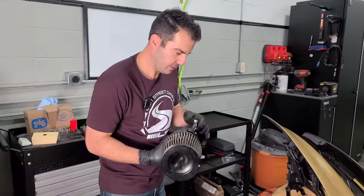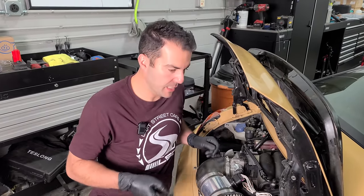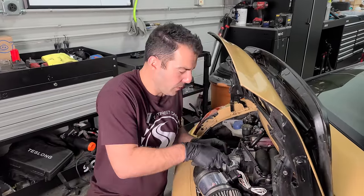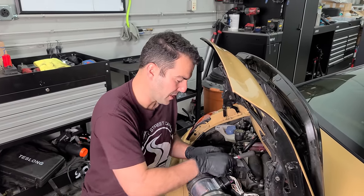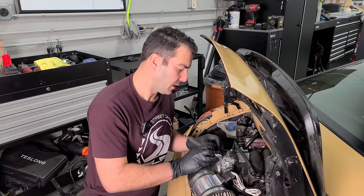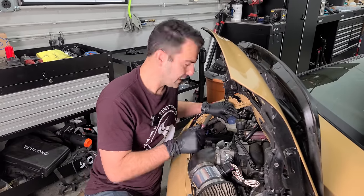That's so weird. All right, guys, here is the game plan. I am going to start this engine and let it run and start to duplicate the overheating issue. So I'm going to do that actually with that fan unplugged, and then we're going to plug it in and see if that fixes it. If it doesn't fix it, I think what we have to do is go after the fan speed. I don't feel that that is a high fan speed at all. It's pretty weak. I wonder, because they're messing around with those resistors, if they had an issue with the fan speed, and then during diagnosis they just left that off at the tail end of the previous owner's ownership. They just kind of gave up. This car was just given up on. So anyway, let's start this engine up, see if we can duplicate it, and we'll do the head gasket test.